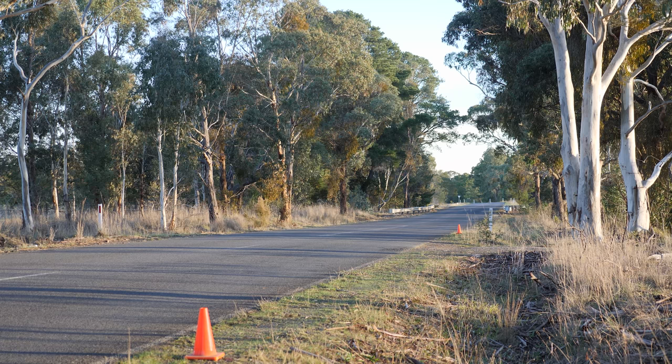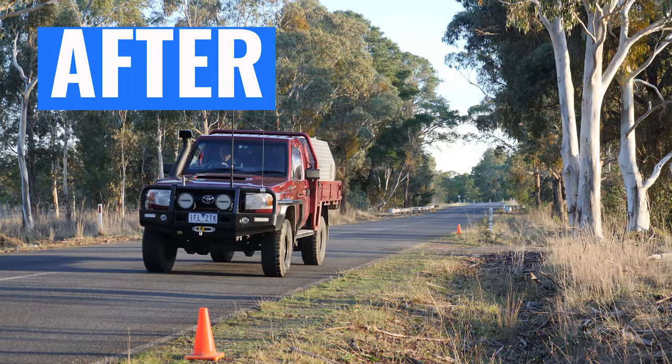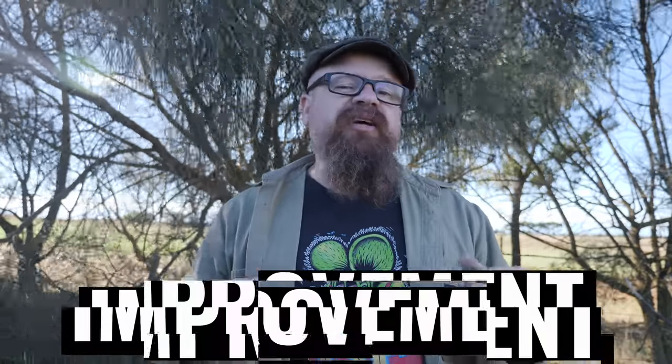The proof's in the pudding. I've set out the cones again on the same stretch of road and we're going to give it a go and see if it pulls up any quicker. You can see the first cone there - that's where we braked last time. We got nearly a 17% improvement in braking from 80 kilometres an hour, and that's no mean feat. The standard brake booster is great for standard rims and a standard vehicle, but as soon as you start loading it up, put GVM upgrades on there, run bigger tyres - only 285 ATs on Chris's rig - you're going to start stressing the standard system and you're going to need help in that department. The brake booster did it for us.